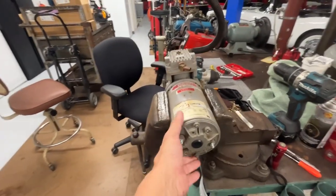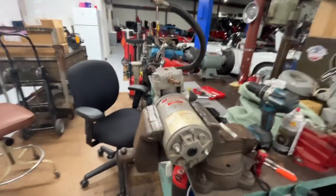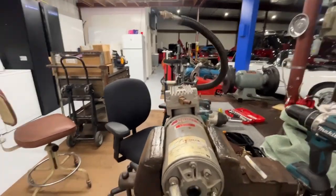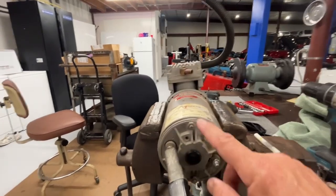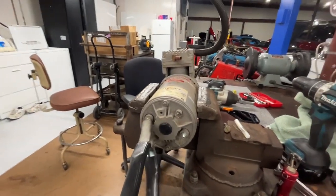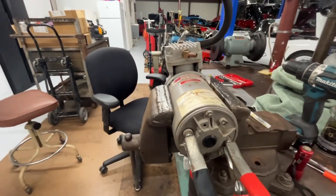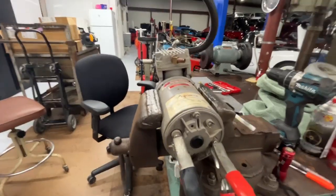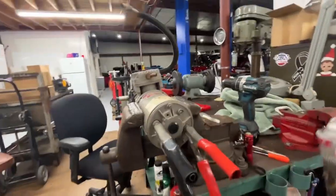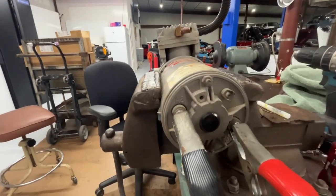So I took this apart — and this is an after-the-fact thing — but it was really an easy fix. It was not working at all, completely open, nothing working on it. Once you have it out, I popped the two things off here and pulled this out, and of course you're going to pop the brushes out of the stator at that point. Basically, the brushes weren't even bad — it was just one of the brushes was stuck. I guess it just got a little corrosion in there, so it was back from the stator. I cleaned them all up, cleaned the stator up, silicone sprayed the brushes, and made sure they were popping back in and out.